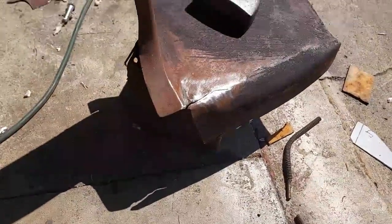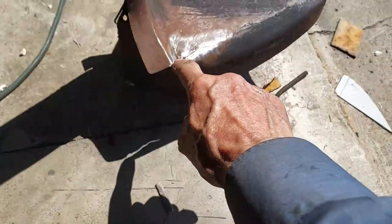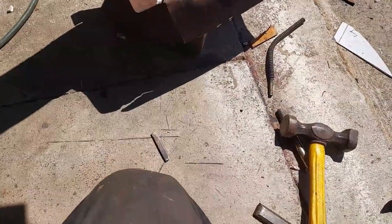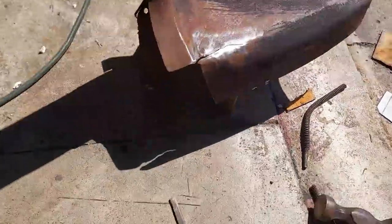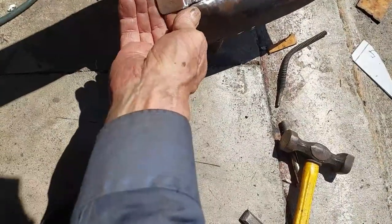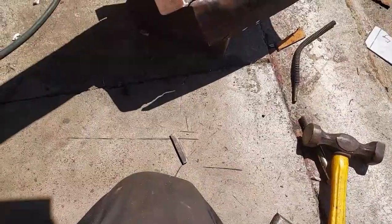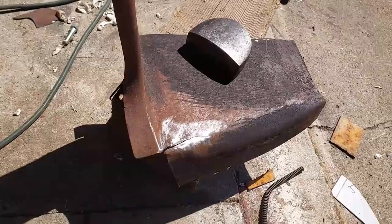Here's the worst crack — this is the passenger side. It's got a couple vertical cracks in it. I kind of put a little dolly back there and hammered it out straight — it was really twisted. I think I'll clean it up a little more, then I'll clamp this together and spot weld this thing together on both sides.